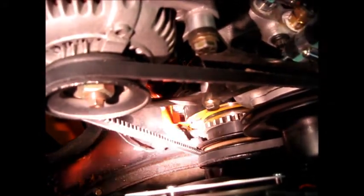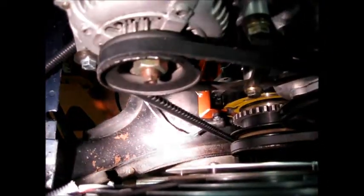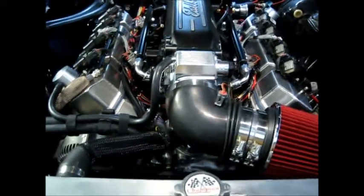The other important one is the VR sensor — it came off of a Ford. You can see it there with the toothed wheel. It's a shielded cable; you can see the shield sticking off that cable. Right now cranking, I get good sync, no loss, and the timing's dead on.